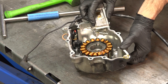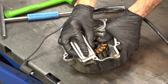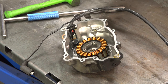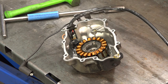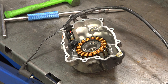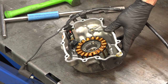The last thing you want to be doing is gouging the aluminum, and the same goes with the cover itself. If you're doing this at home you may just want to consider replacing the whole entire cover. We do offer a rebuild service — I rebuild several of these every month, people mail them to us, it's definitely a little cheaper to rebuild them. But the casting is not that expensive with a brand new water pump in it. Keep in mind there are several variations of this cover — the water pump is pretty much the same from 250 and 300, but how the stator mounts and other parts have changed over the years, so it's very specific to the VIN number of your scooter.